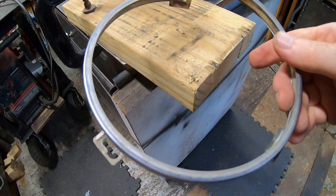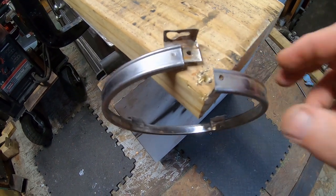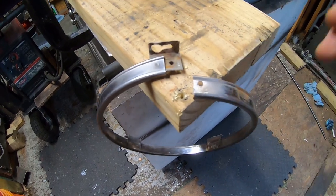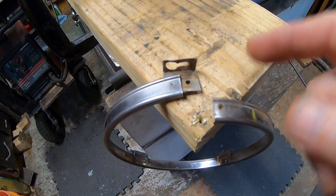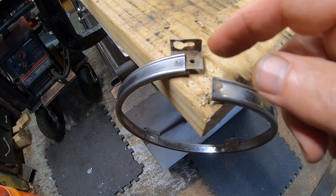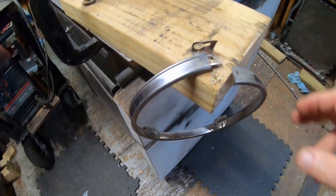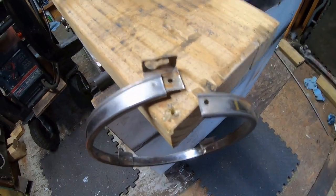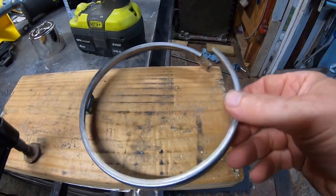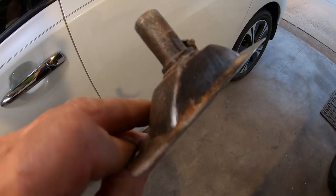I think I found the best fix for these headlight retainers — a bunch of mine are broken and they're spot welded stainless steel. It's been taking me forever to figure out a way to fix them. I took an eighth-inch drill bit, which is three millimeters, so I can put in a three-millimeter rivet. The trick to drilling a hole in these is to just put it over a piece of wood — so much easier. I've already done one and it worked. These are about 30 bucks new, but this repair works. I'm really impressed with what the acid did to clean these things.